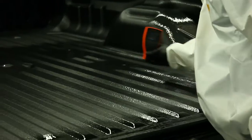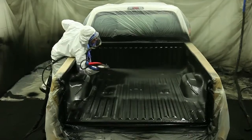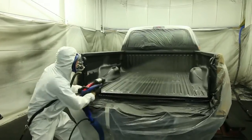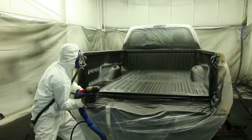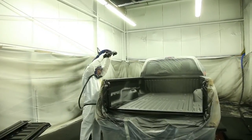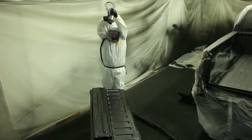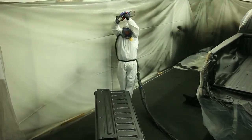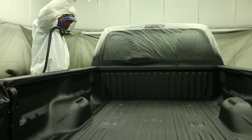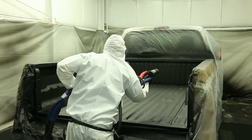Check the thickness of the Rhino Linings material using your thickness gauge. Finally, texture the bedside and bulkhead from the side of the truck using several short quick blasts. It may take a few passes to get the texture just right. Texture the bedside and bulkhead again from the ground level. Always texture the floor last, as it will have been textured quite a bit from the other areas and you will only have to touch it up. Return to the tailgate, make sure the access cover is in its position and raised up on blocks, then texture the tailgate. Prior to unmasking the vehicle, complete one last inspection — look for inconsistent texture, glossy or thin spots, particularly under rails or stake pockets. Texture again if necessary.